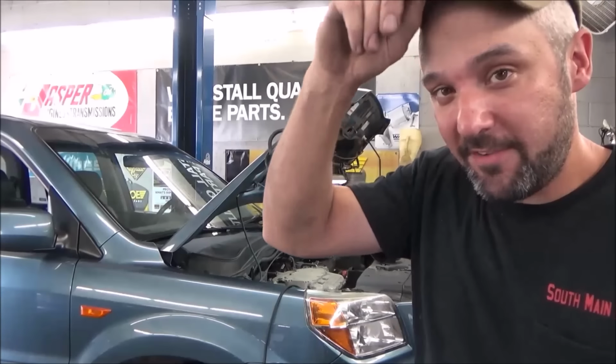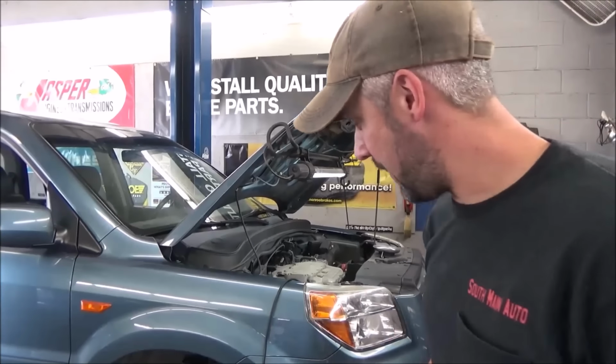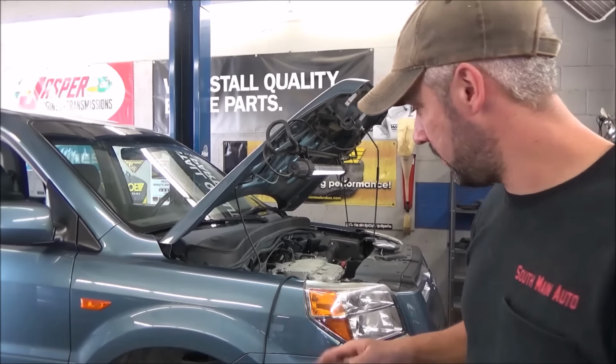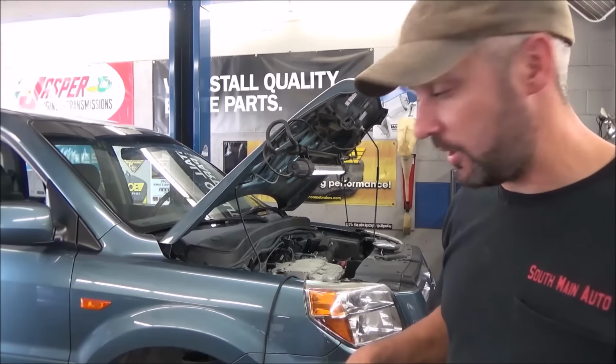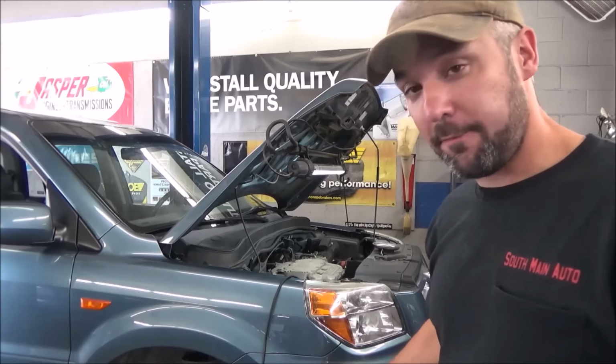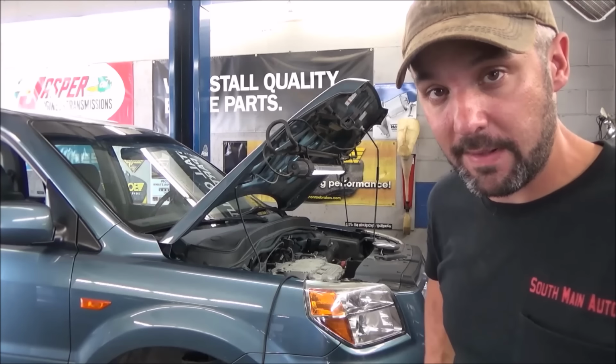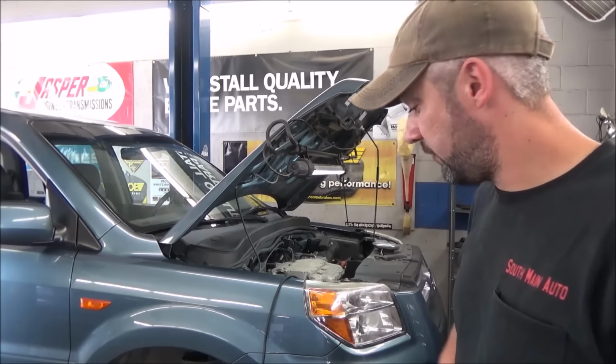Well, I hope the video hasn't been too wiggly so far. It's harder than I thought to record. So right now I'm going to take, I don't know where we left off. I had to go eat some lunch, but I got the floor jack underneath the oil pan right now, because the next thing we have to do is pull this motor mount off, and I think that's where we left off. So you got to support your engine.